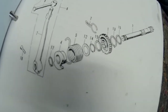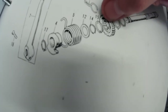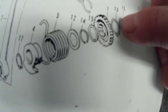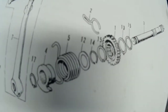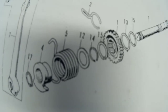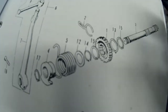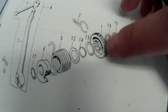The end of this spring goes on the side of your cover — you'll see what I mean when you take it apart. What happened with me is that this clip right here came off the gear. It sits inside this gear; you can see a little bit with the shadowing, it goes right inside. That's the reason why it wouldn't engage. So if that happens to you where you're kicking it and it doesn't make a difference when you're adjusting the clutch, then chances are it's because this spring is either broken or it came off the gear.